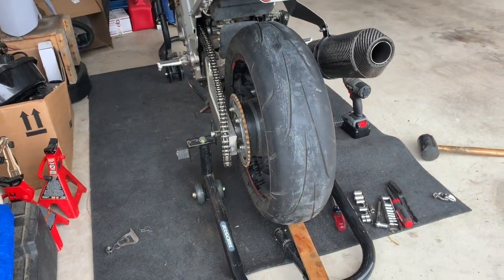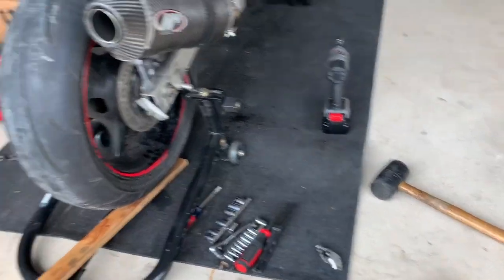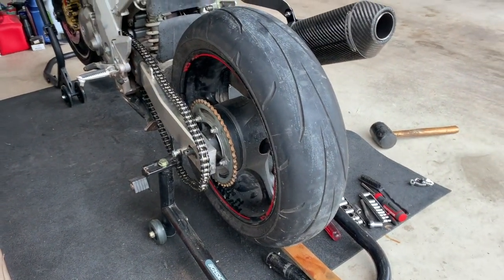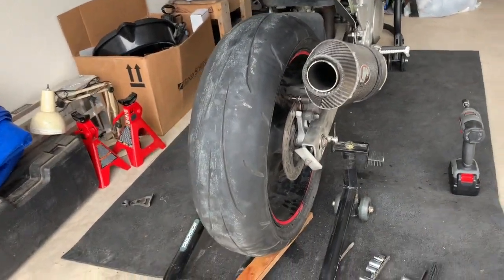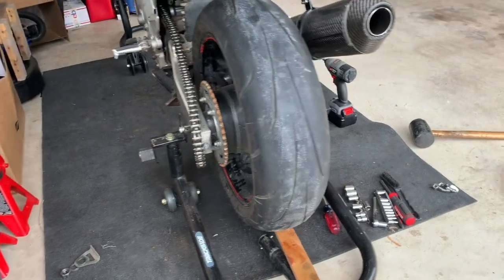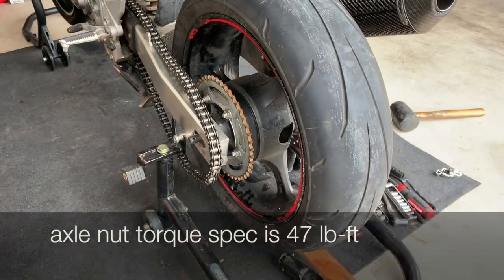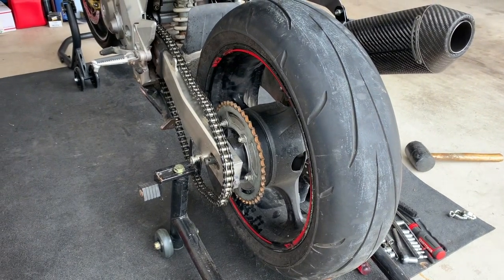We cussed and we wiggled and we jiggled and we hit — and we are on there. It helps to have a mallet ready to help drive in that axle. Once you get everything lined up, it's a little sticky but we are in. Let's make sure our brake disc isn't dragging on anything, we'll see about that chain situation, and we'll get everything torqued down. I'll look up the torque spec and put it down in the description — for the caliper bracket bolts as well as your axle bolt.